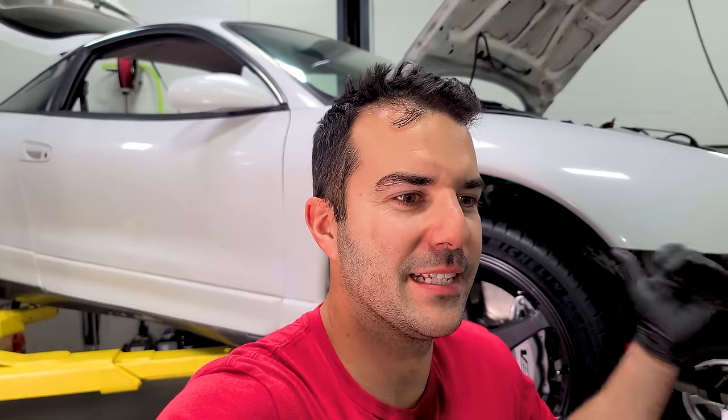The CTS-V and this car have nothing to do with each other, but I like how it looks. I'm a little worried — the tire is poking out. I had to run the spacer for the brakes, and these are the trials and tribulations of wheel and tire fitment. We're still up in the air — this could settle in. This is what I was talking about with camber — I might have to camber the top in, roll the fender, stuff like that. It is what it is, we'll get there. Driver's side is all done.